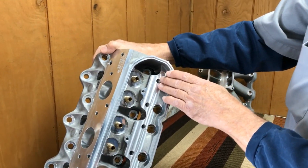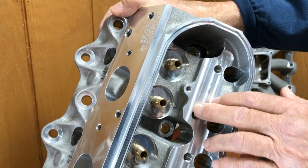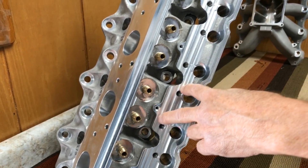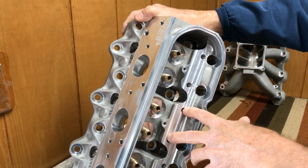If you also notice up here on the rocker side, instead of the little piddly 8-millimeter things that hold the rockers on, everything is done with a 7/16. And it's staggered, so it actually has forward motion this way, and that way you get a better torque value.